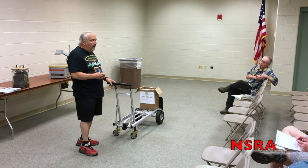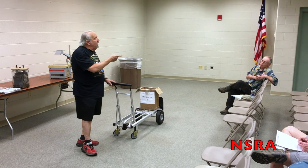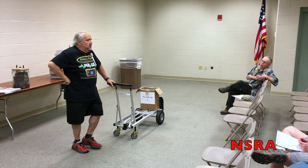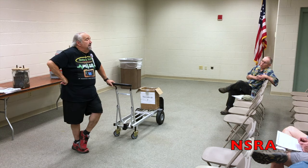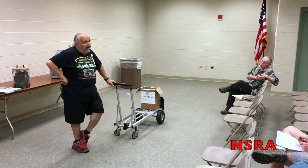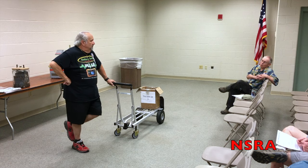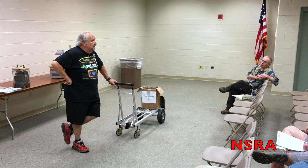And so what you end up with is cracks. Even if the crack doesn't kill the battery right away, it will kill it in a short amount of time. And so that's another thing about batteries. If you're in super cold and you don't have a choice, you've got to drive that battery. And if you don't drive that battery, you should definitely look into something that exercises the battery while you're not using it. If you don't, they will die prematurely.